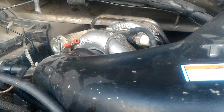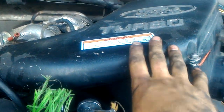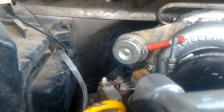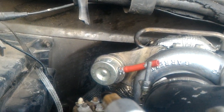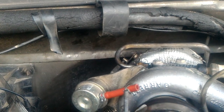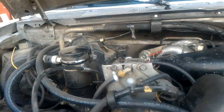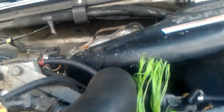Within the last hour I did the swap. You've got to pull the airbox off. You want to detach your battery because you're going to be working right down there by the glow plug relay. The wastegate here — I need to connect that rod back up because I want it to stay shut. That was just because I took the thing off.